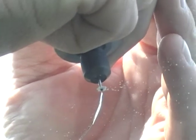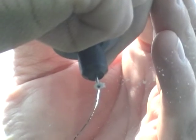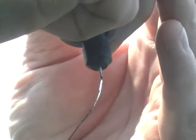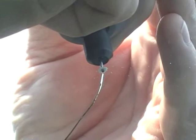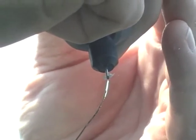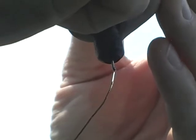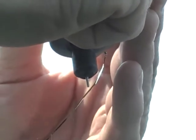Use light pressure and don't break the drill bit off. While you're drilling on your windshield, if you're doing cracks, it's best to use a newer drill bit — it cuts easier and you don't have to use as much pressure. If the bit's old, you have to press down harder and you can cause the crack to spread. If you press too hard, you can sometimes bend the bit and break it off inside, which can cause other complications.